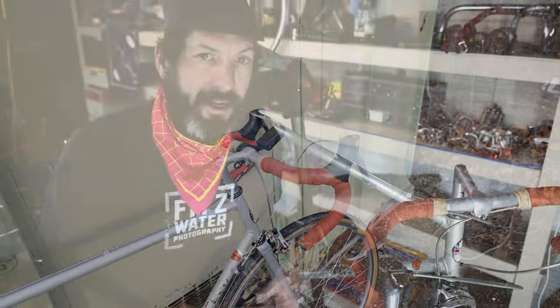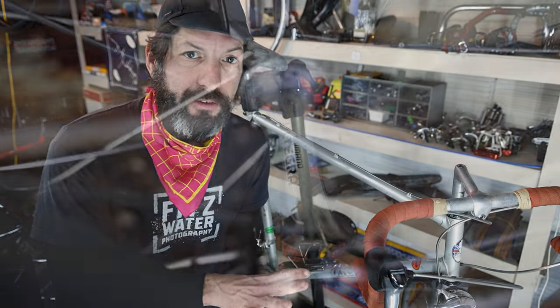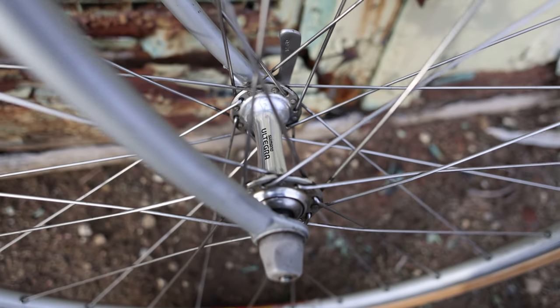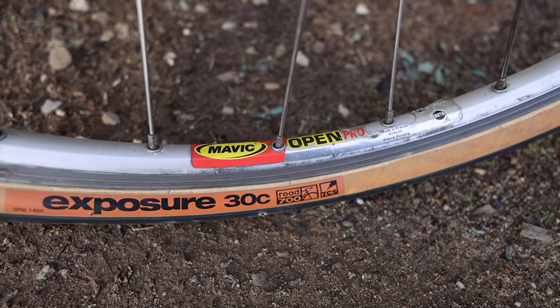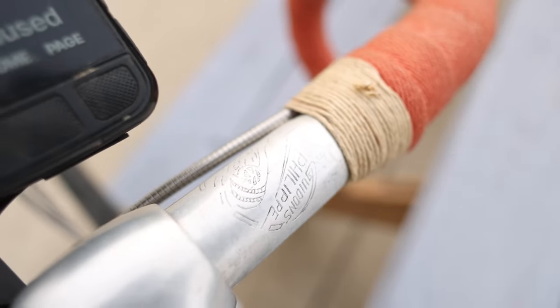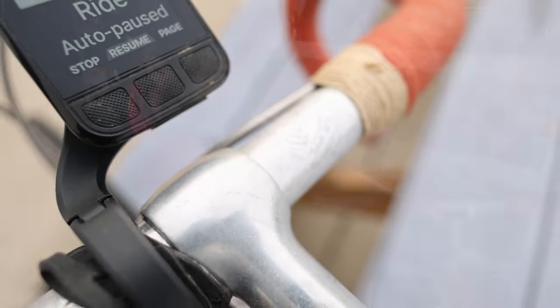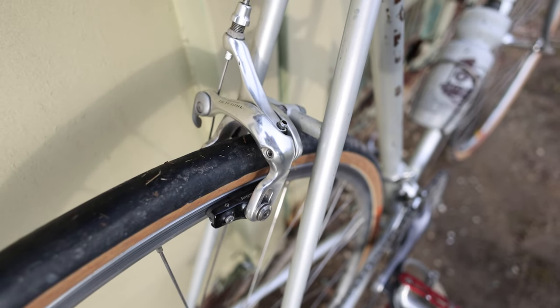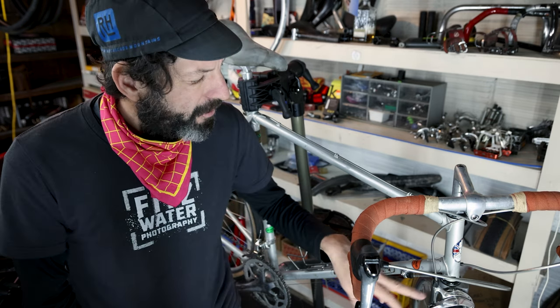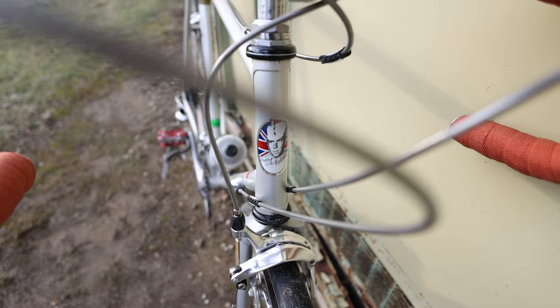Then my friend Yana, who's the mechanic at Dirty River, had this wheelset hanging in his garage — Shimano Ultegra hubs laced to Mavic Open Pro rims, so those look kind of cool. I got these old bars from Otis at Dirty River; he was just getting rid of them. They're ADX, I believe — a little bit wide and not too deep of a drop, so kind of perfect for that. I had some old brakes that worked: it's an Ultegra brake in the back, which is actually a front brake because I needed the longer bolt for the way the bridge works on this bike, and in the front I have a Tektro that has kind of a long reach.